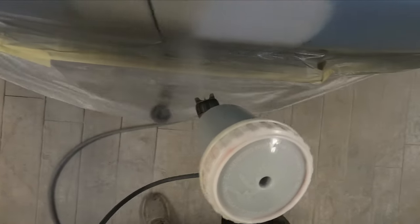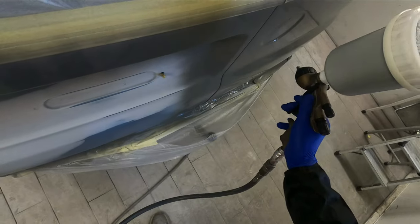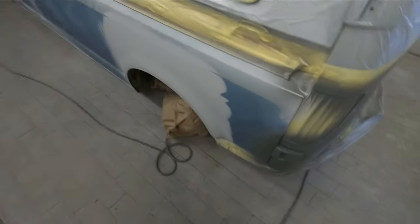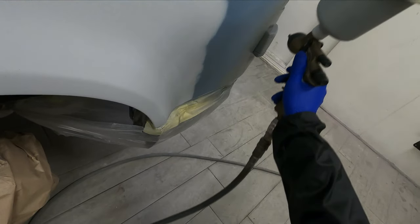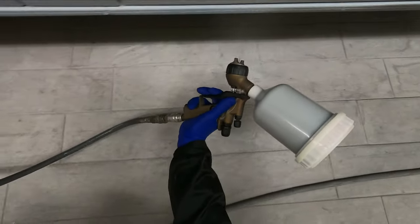In order to do this job, what we had to do was fully mask the van for a respray. But at the same time because we're doing this two-tone and getting rid of the old two-tone, inside the doors we've had to mask up all the insides of the doors and then fine line off around the edges, so that when we've put this colour down there'll be a nice clean edge inside all the door shuts. Because if we just used soft foam it'd give like a feathered edge. So I've just stepped the fine line in a couple of millimetres, fine lined a nice neat lip around the inners of the door shuts, and then put masking tape all over the door shut where the overspray is going to go, so when the job's done and I pull that fine line out there'll be a real nice clean crisp line inside all the shuts.